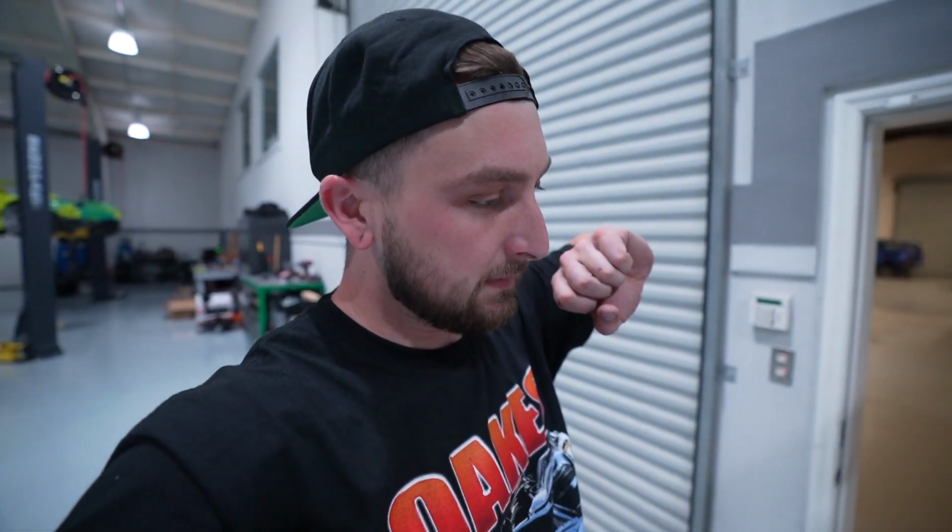So it has a Turbo Smart wastegate on it, which is really hard to pinch the diaphragms in compared to a Tial. Like Tial, it's very common, and that's something you might see with a Tial, but it's basically a straight pipe 3-inch exhaust, so we know it's not that. The manifold and that turbo, I have the exact same one in my SRZ. The cams are bigger on this motor, but not enough. There could still be something wrong internally in the gate. It's hard on the Turbo Smarts too.